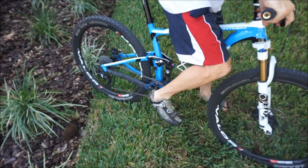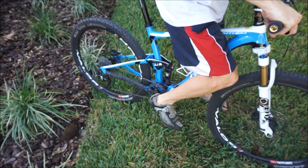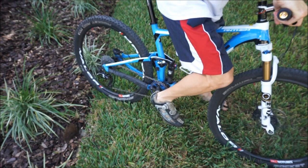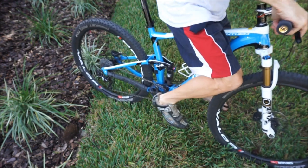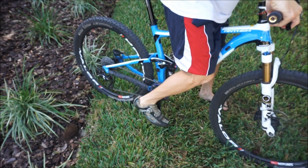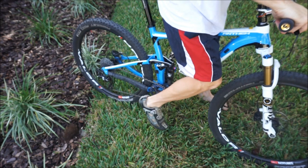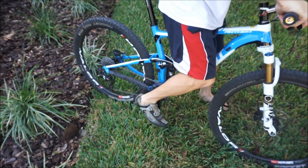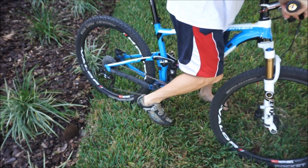Let me demonstrate. I'm going to click in — this is the standard Shimano pedal with the SH51. So I'm clipped in. If I try to pick my foot up to the side, it won't clip out. But if I move it completely sideways, then it will clip out. Clipping in again — pulling up, pulling up to the side — it's not coming out. I have to move my heel completely sideways to click out.